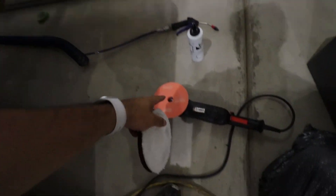On a Ram like this, the clear coat is not too soft, so it's not leaving too much haze behind — this is my go-to pad. Always do a test spot beforehand and try out different combinations to figure out what process makes your life easier. Doing a paint correction is not something you can just learn right away. It takes a lot of practice — go to the junkyard, buy a couple of hoods, and test out how the polisher works.